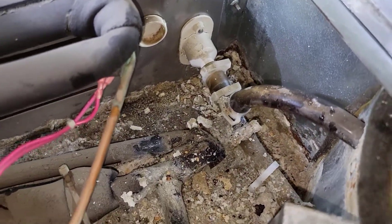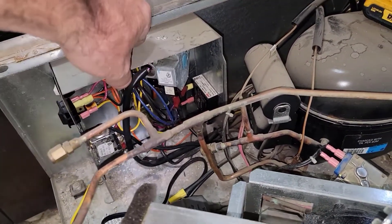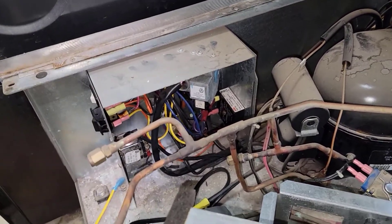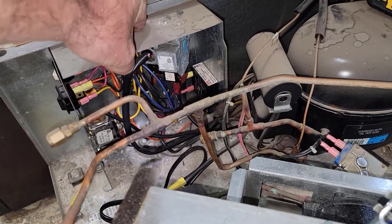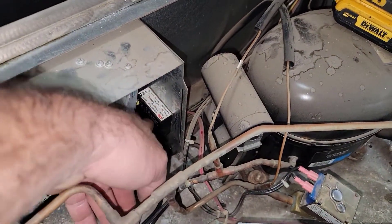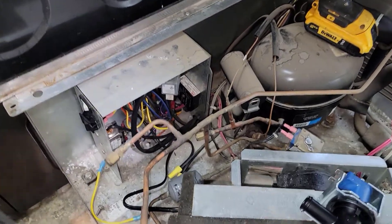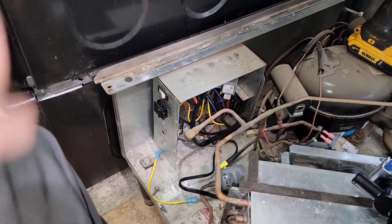Put that in there - looks like it's been leaking in there for a while, but that's just calcium, won't hurt anything. For the controls - I don't know what the mechanical timer is for... some sort of combination pressure switch. It's been a long time since I've worked on these in the field. Probably just the actual low pressure switch, might be adjustable. When the suction pressure gets down to a certain point it closes, then you add time past that point and the harvest starts. It's an ABB brand timer. Here's the bin full thermostat - I'll probably just crank it all the way or bypass it.